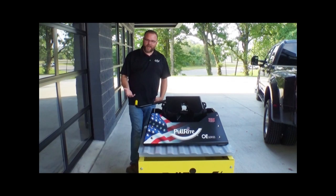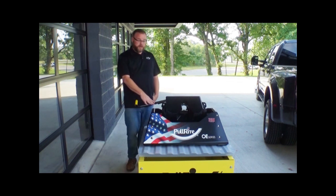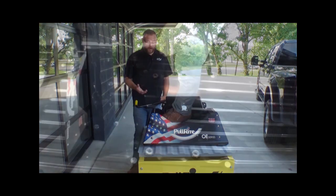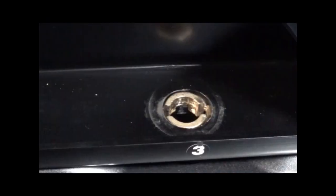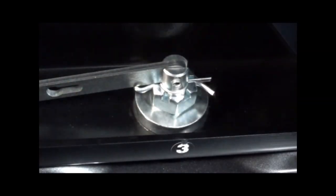The next hitch we'll talk about is our OE Super Fifth, which is basically a non-sliding fifth wheel hitch. It's designed for an eight foot bed truck, so when you don't need that additional clearance for a standard short box and you have an eight foot bed truck, this is likely going to be one of the best options for your fifth wheel prep package. This hitch uses all those same mounting posts, the same washers — all of that — it's very similar and just as secure as the Superglide, but the base doesn't offer any sliding functionality.